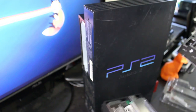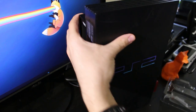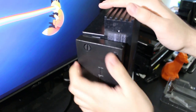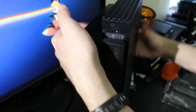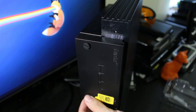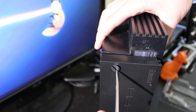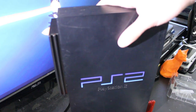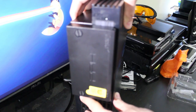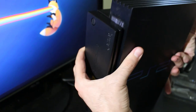Anyways, let's go ahead and slap this in. I'll show you how it goes in, just to make sure we get a proper fit. Just pop that in, turn the PS2 around, slide the hard drive in — goes in with pretty much no issue. Just have to make sure that it connects to the PlayStation console itself. Then let's go ahead and get this screwed in. It's actually recommended that you screw these in with a nickel or a coin of some kind as opposed to a screwdriver, but I'm going to screw this in with a little tiny screwdriver I have on my desk since it's more convenient than finding some change. There we go — we have it all screwed in. As you can see, it doesn't fit quite as flush, and it might be a little bit crooked, but honestly it seems to be okay.